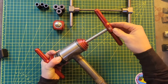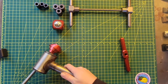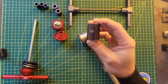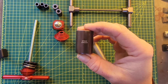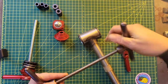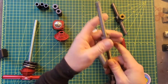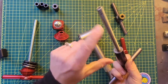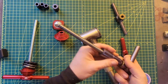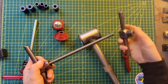So on their hub bearing press, they came up with a different solution. Instead of threading it all the way down, you would use what they called a speed spacer. So they made speed spacers for their hub bearing press — you'd put your pieces on and space out with the speed spacers so the threading of the rod was only so long, and then you could push in without having to thread the other arm quite so far. As far as I know, they don't make speed spacers for the bottom bracket press, at least not the one that I have from them.